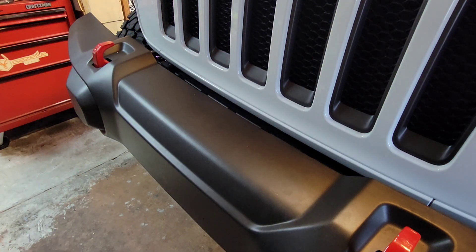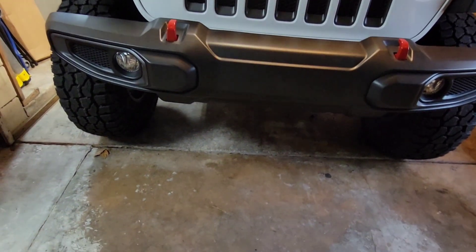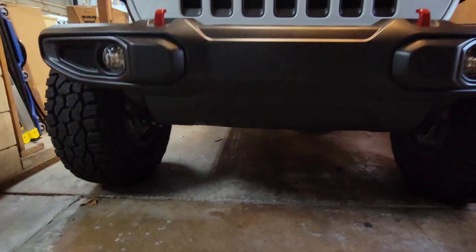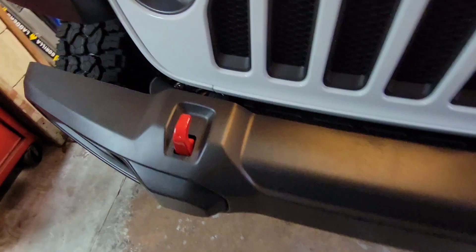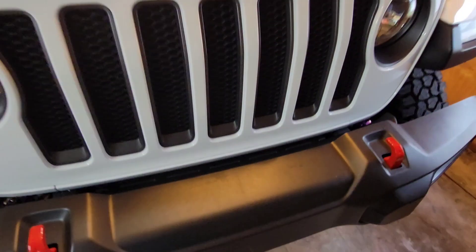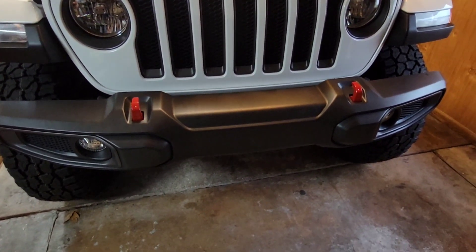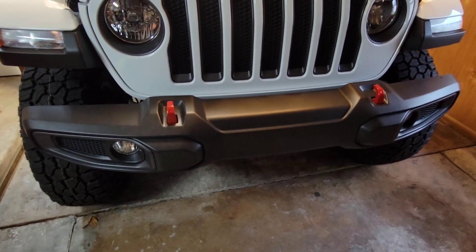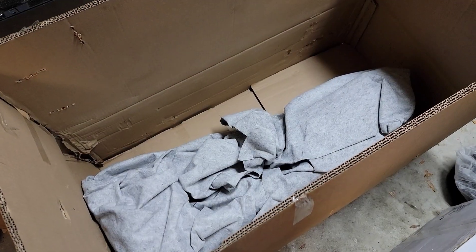Following Warn's instructions — pretty much the same as every bumper install — going to pull off the underside plastic splash pan, because it's not really a skid plate on this thing, and then the fascia, this plastic trim right inside here. Then get behind the bumper, pull out the bolts, and remove the whole front end. The new Warn bumper does not reuse the fog lights, so I don't need to deal with pulling out that harness. It also doesn't reuse the recovery points, same as the rear bumper.